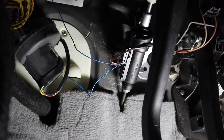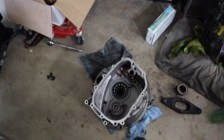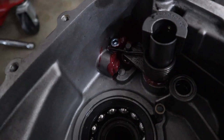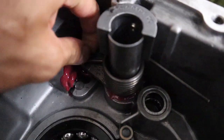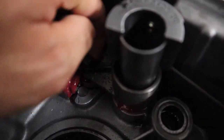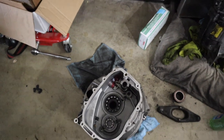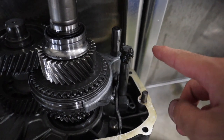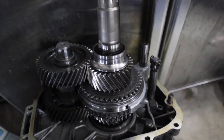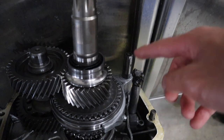I'm really just waiting for the bell housing to come back from being machined and then everything should be ready to get back together. I got the bell housing back. The pins and detents are all in, and this spring is what causes it to center back — this thing is now hard. Before it was easy and free to move, and now you've got to really put some force into it. That's what causes the shifter to go back into neutral. Next up is putting the bell housing back onto the transmission. I put some assembly lube on this area. One of these washers was the one that came off, so it's helpful to keep the assembly lube on it so it doesn't fall back off when we put the bell housing back on.